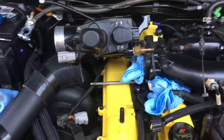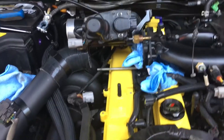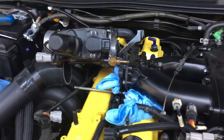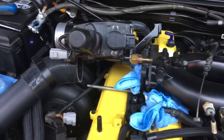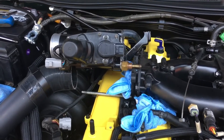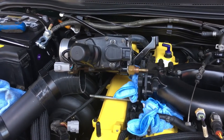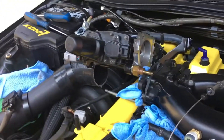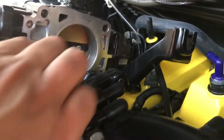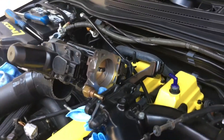One of the things that's been a little troubling on this build is getting the car to idle once it's running. Part of that issue is in the tune, and also it may not be getting enough air — it might be starving for air and having too much fuel. We tried some things and it didn't quite work out, so the next step is to drill a hole in the throttle body plate — an eighth-inch hole on the upper part — and we'll see if that can help with the idle.